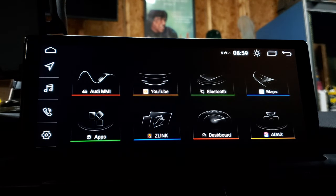Back at the home screen, another thing to talk about is the dashboard app. This brings up a digital dashboard with a tachometer and speedometer. It also shows if your parking brake is enabled and if someone doesn't have their seatbelt on. It shows fuel remaining in gallons and the ambient air temperature. A tip: if you turn this on and it shows something like negative 32 degrees Celsius or zero gallons of gas, that means one of your wiring harness connections isn't correct — open everything up and make sure it's fully seated, especially the quadlock wiring harness. In driving around with this, the tachometer is spot on, but the miles per hour seems to be about four to five miles per hour fast.